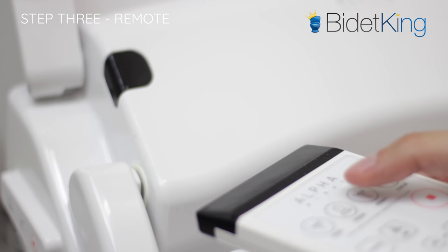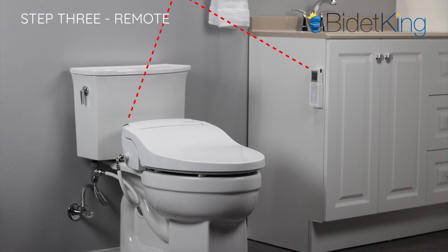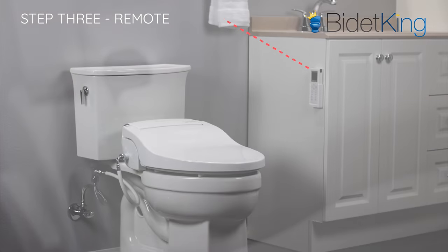If the functions are not working, repeat these same steps once more while seated on the seat to ensure that the skin sensor is triggered. During this part of the test, we want to make sure your remote is pointing at your seat's IR sensor. Take the remote control and point it in an exaggerated fashion over your right shoulder, directly at the IR receiver.